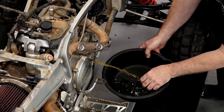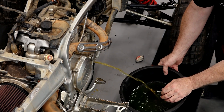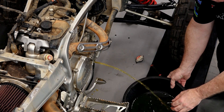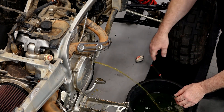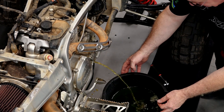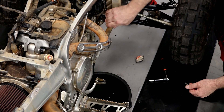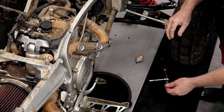Well, we drained the water out of the top end, flushed out the crankcase, and she still didn't want to start. Turns out it doesn't have hardly any compression. More than likely we're going to find that the water caused it to push down on the rings and now they're no longer sealing the cylinder.